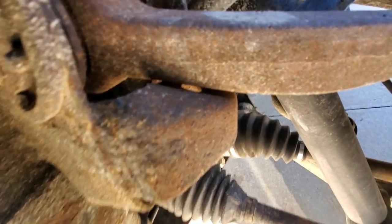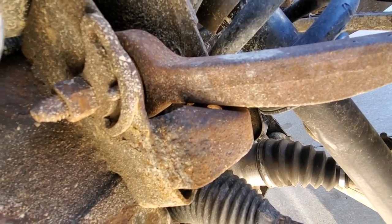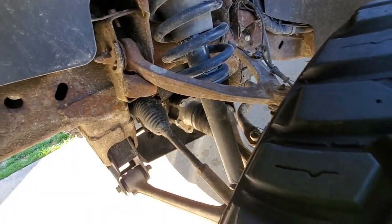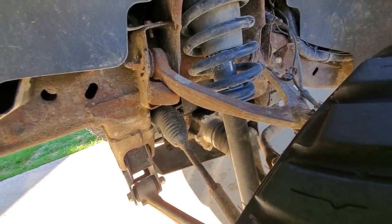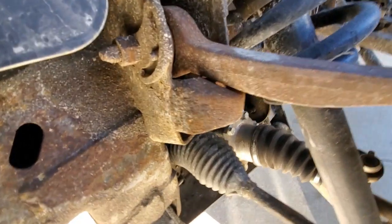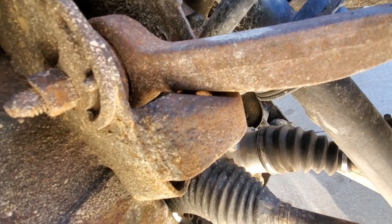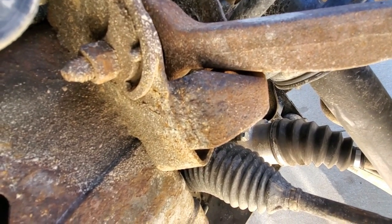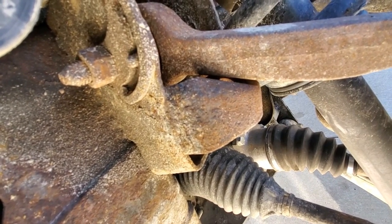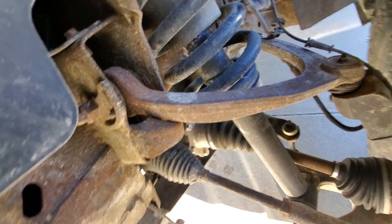Another issue I have is you are very close to your bump stop. So your down travel, you don't have very much of. Which I think is because this is actually a 5-inch kit that they stretched to 7.5. So you don't hear or feel that going down the road, but you don't have much downward flex, which could be part of, I guess, a stretching issue they had with moving everything. But maybe if I get lifted control arms, that might help that a little bit.